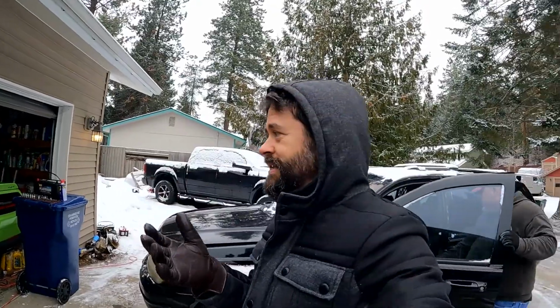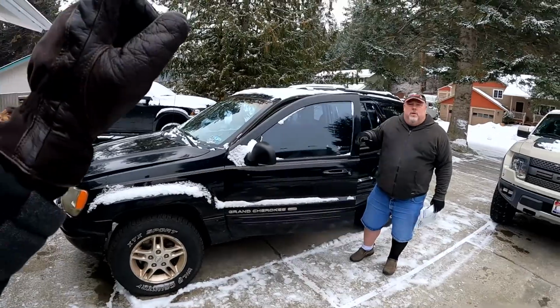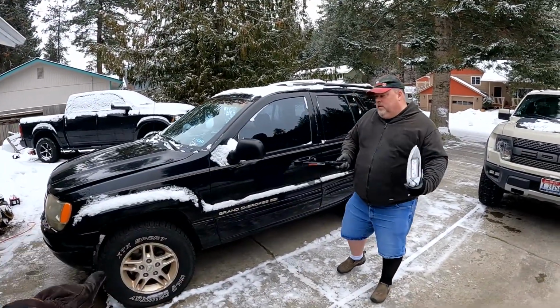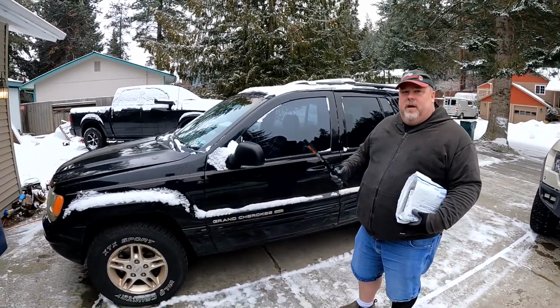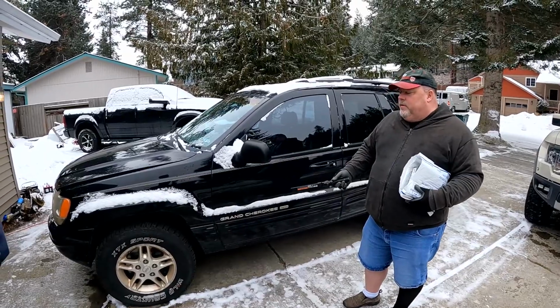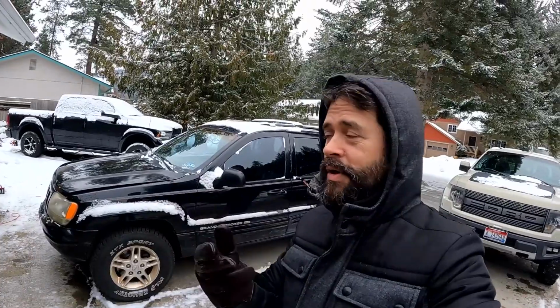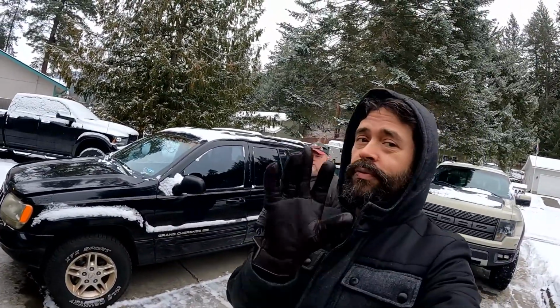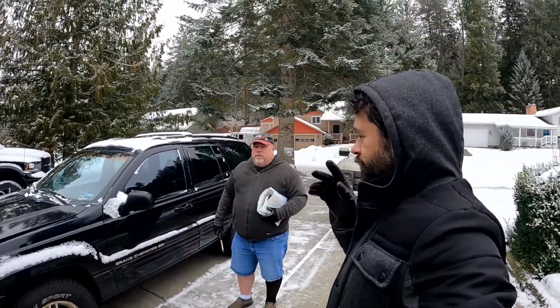But again, then we ran into some safety issues like last time, which was, what all did you change last time? It was brakes. Yeah, I replaced the CV axles, upper and lower ball joints, hub bearing unit, rotors, and brake pads. Stuff that's somewhat important. And so today, we found a few other items that are safety related, but we are focusing on the transmission as well. So my name's Uncle Jake, by the way. If you're new to the channel, welcome.